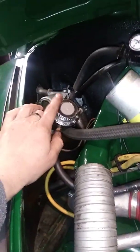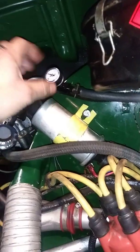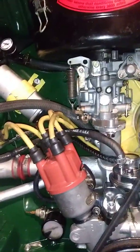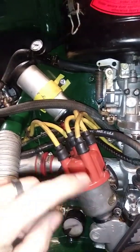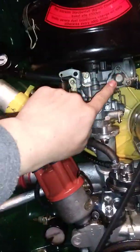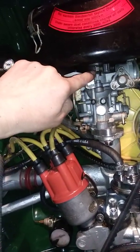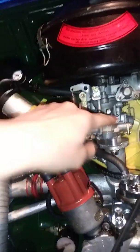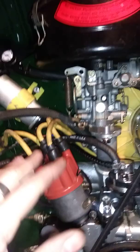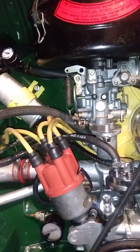I put a regulator on it just to test. When I started the car it's about three pounds, which is more than enough. I changed some jetting and checked the spark plug — it was burning pretty lean, the ceramic was kind of white, around the ring was black, and the electrode was grayish-white. So I went to the air jet and changed it to a smaller one. I had a bunch of jets so I went up and down until finally I got this thing to do 25 miles per gallon.